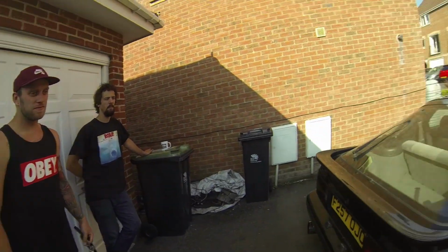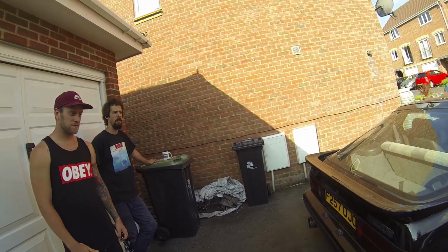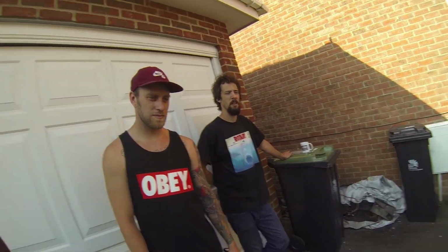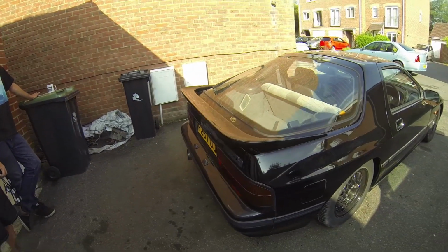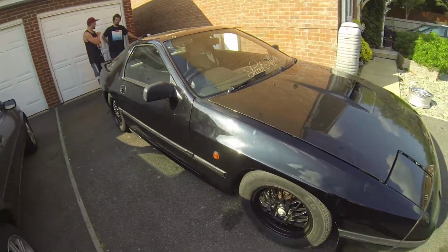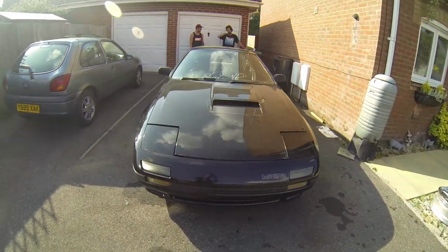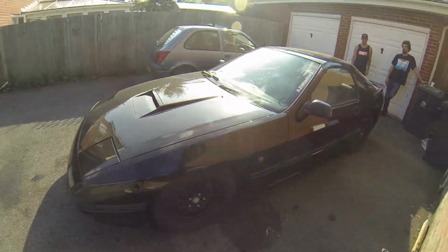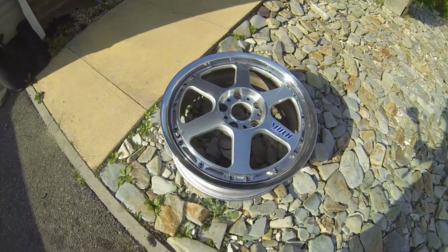But yeah, we changed the binnacle thing around the clocks, didn't we? Yes. And that's made the wipers work, the indicators kind of work. So they're all the switches from the Series 5 now. Yeah. What else is working? Oh, the pop-up headlights. Are now popping up. And down. We changed one of the earths as well, didn't we? Yeah, so it wasn't really popping up very quickly. It just looks so good. You can't help but just stare at it all day. She's lovely. And then John's got these to go on. They should look great.